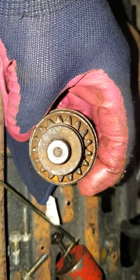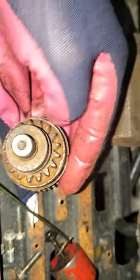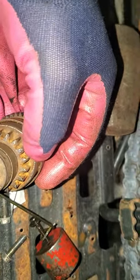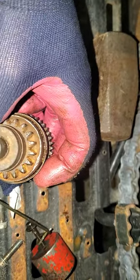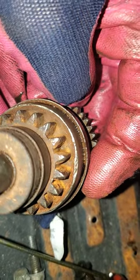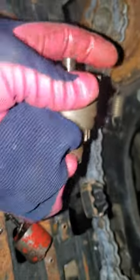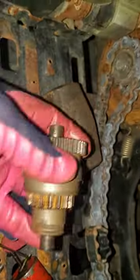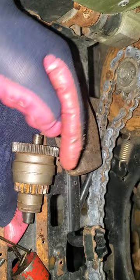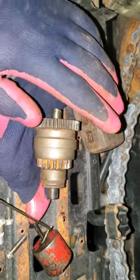Hopefully you don't need a new one of these, but it doesn't look like it's just rust holding it back. The edge is kind of folded over the part of this gear here at the bottom — see how that's kind of folded over the edge, keeping it from extending out. This thing has internal springs and all that stuff, and this is a mechanism that's supposed to shoot that gear out, but it's just locked up for some reason.